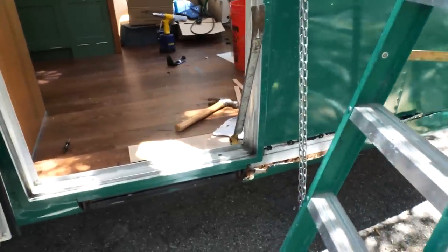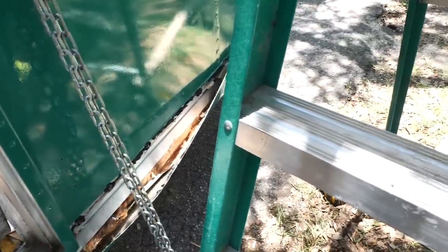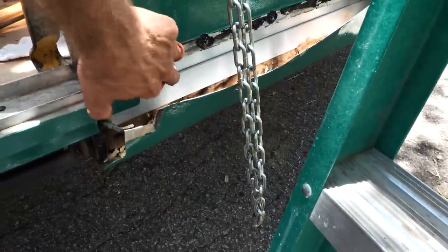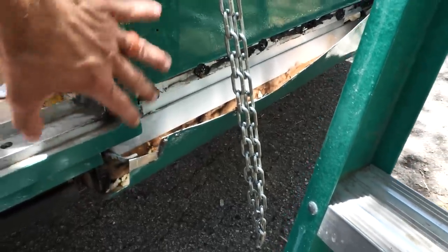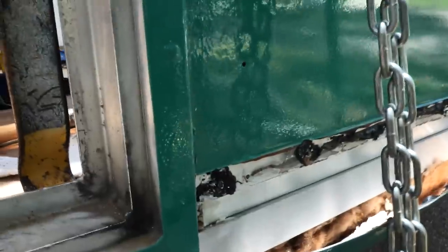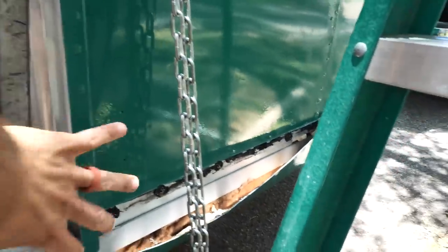And so what we're doing is we've torn off this belly pan. Torn off is the wrong word. We've taken the rivets out, let it loose. Basically, this section of the shell, which rivets to a C channel down here on the subfloor and attached to the frame, taking that off frees up this bit of the shell, frees up this frame. And if you get a crowbar under here, you can kind of see, it's hard to do here, but you can move this whole door frame and this section of the shell up.